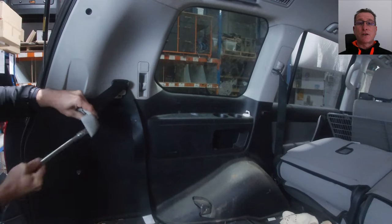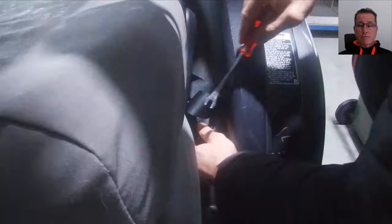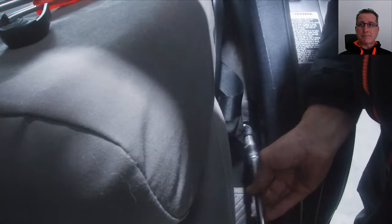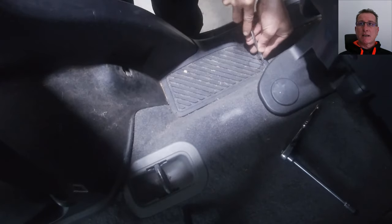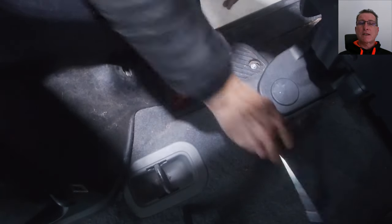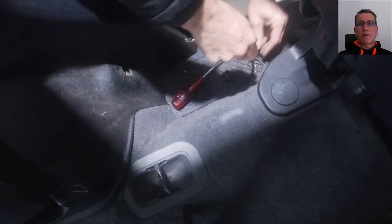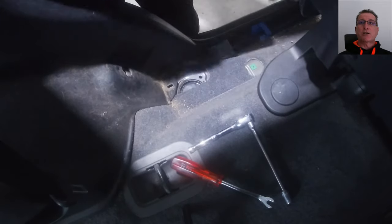This is the process to get those trims off — basically removing the seatbelt mounts, the third row top, and this second row lower mount. All these actually go through that lower interior trim, so to get that off we need to get all these undone. We also need to remove this lower trim at the second row seats and the lower door trim, because the rear arch trim in the back actually goes underneath this. Just undo that 10mm screw and pop it out.